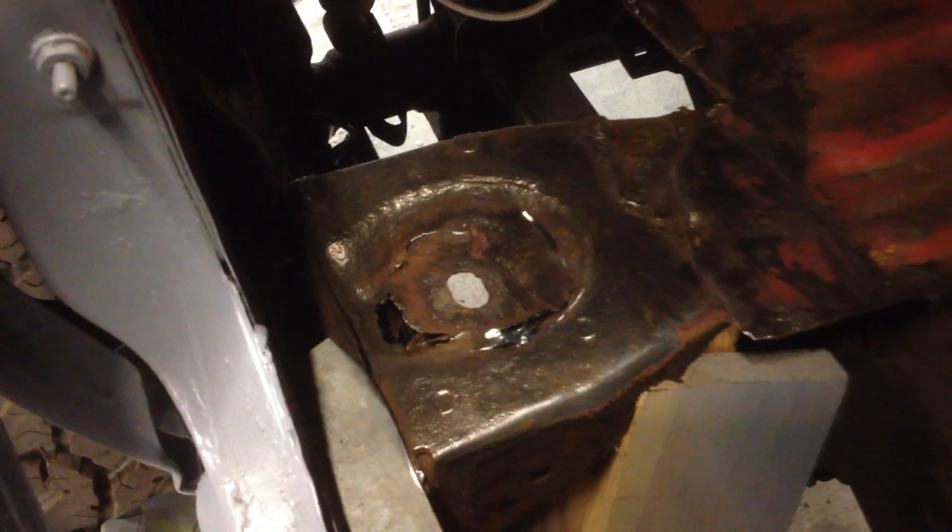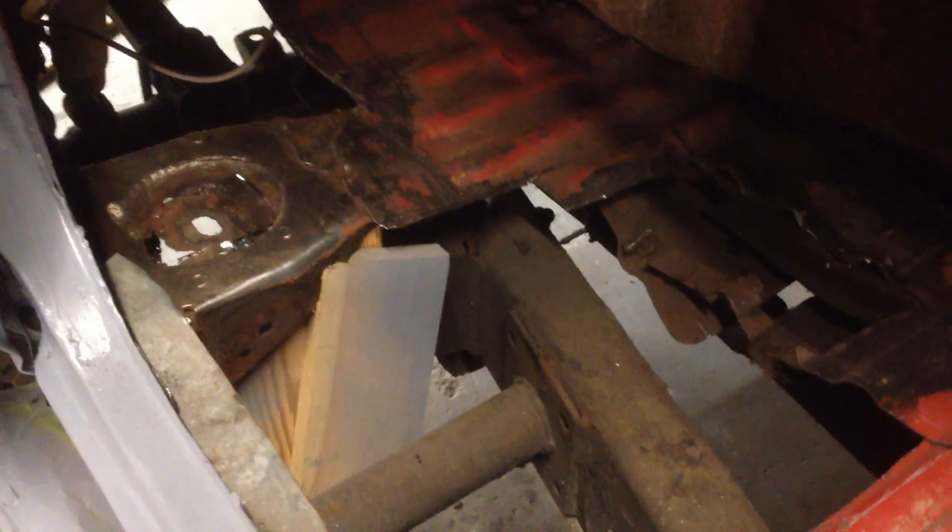Here's how I'm fixing this: first I cut out all the obvious rust. You can see over this mounting area that the floor actually just rusted away — you can still see the spot welds where they were, and it all just rotted away. I ground it all out and it left as dust. What I did was I jacked up this area with some wood and a jack — kind of sketchy, but it worked — raised it up enough to unbolt the mount and pull it out. Now I've got room to cut this rotted area out, because the mount was just pushing right through that whole area. I'm going to have to rebuild and reinforce it, then worry about the floor, because that's just sheet metal.